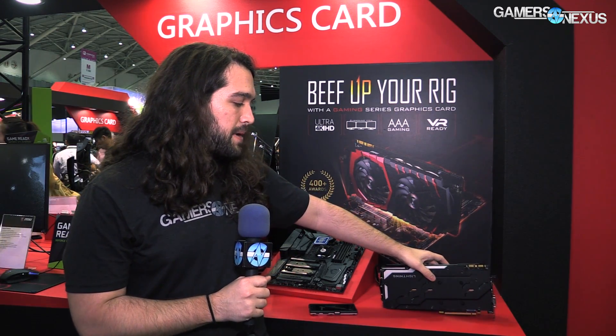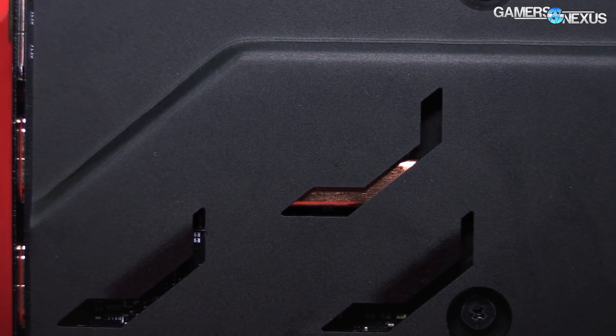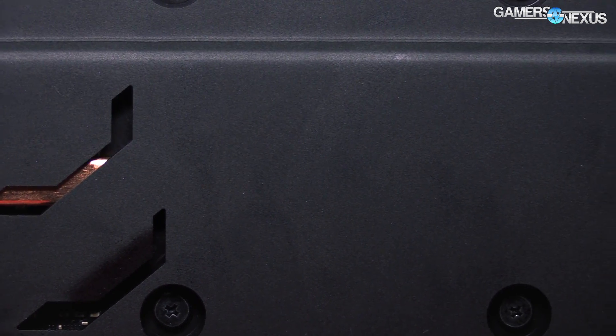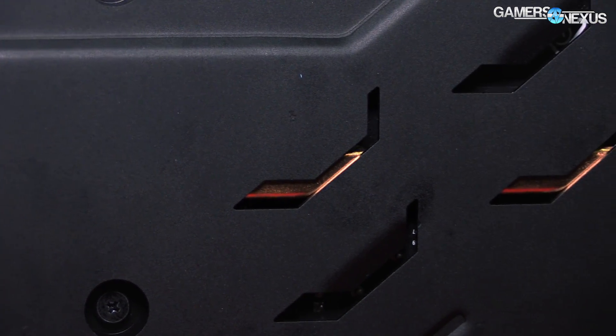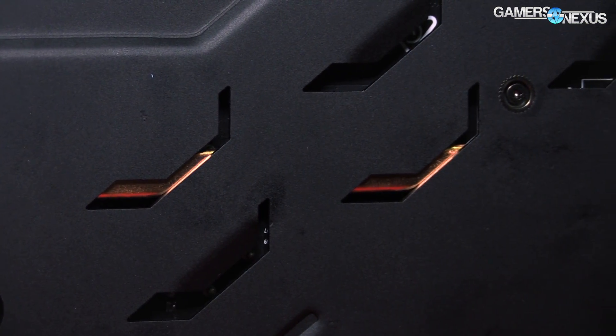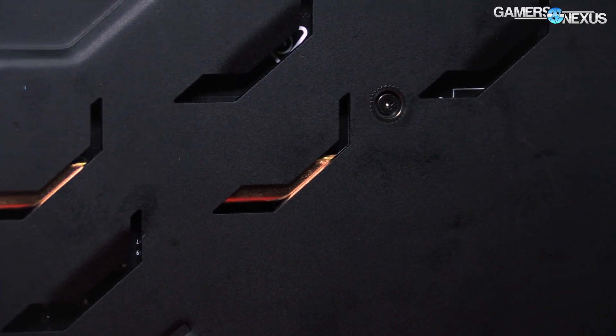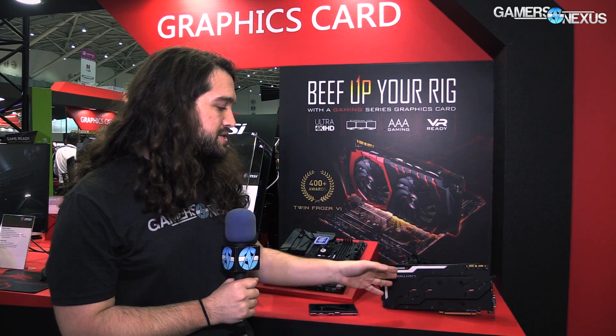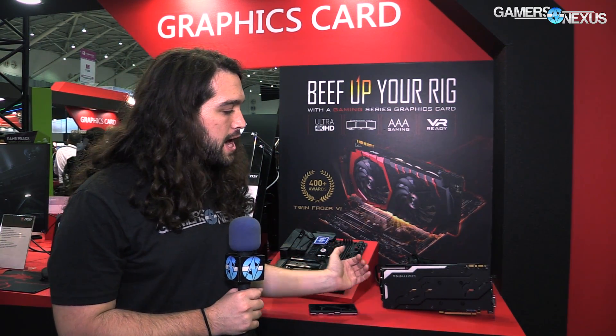One of those is on the backside. You can see here there's actually a copper heat pipe running through the length of the card. To get the full extent of this, you wouldn't really want to test it on an open-air bench with no air cooling — you would want some kind of fan blowing on it. If you're using it in a normal scenario or have direct airflow, this heat pipe should help sink heat from the hottest area of the board, which is right where the inductors and MOSFETs are, and also the GPU side.